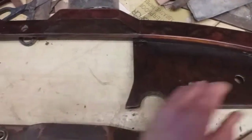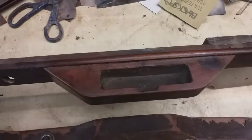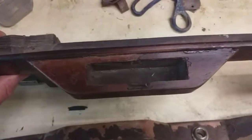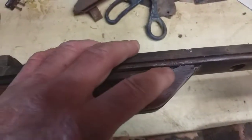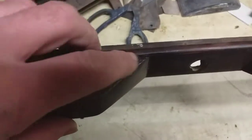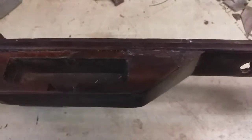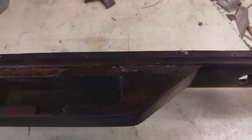And then these are my repairs to the top, and that side's good. Bit more trouble with this side. The piece on the right there, that was very fragile, that veneer, and it's not really survived. I don't mind that bit, I can put some wax in there, but I'm going to do a repair to the repair and a little cut across there, just splice a new piece in. That's that little repair done, just glued in. Little overhang here which I'll sand off. And that's dry.